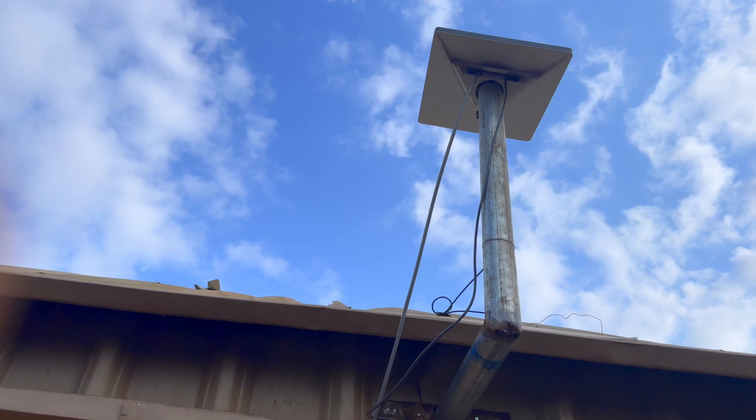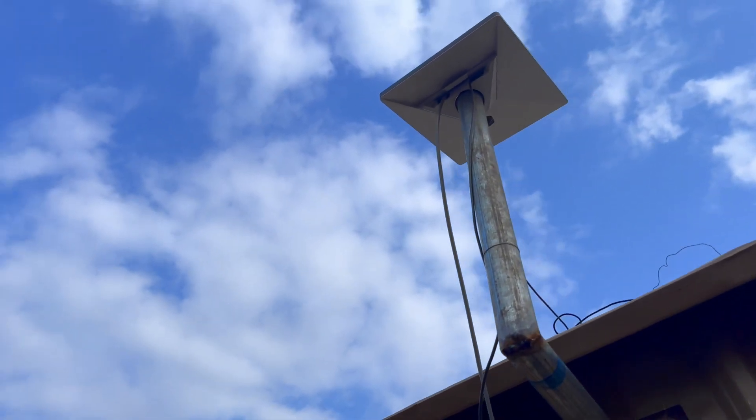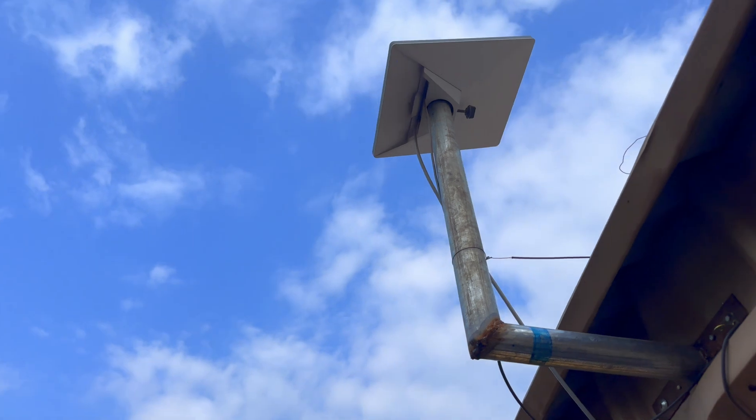Being one month plus, I've been able to get a TP-Link router that I use to connect the other side of the house. I'm going to show you exactly where I mounted the Starlink router outside. Being a Starlink Mini, the router is mounted inside the dish, so the distance you have from the dish will throttle down your Wi-Fi speed. I've been able to get a router here that serves every other part of the house, and I'm going to show you how I got that done by myself. In case you don't have the money to buy an extra router, I'll show you what you can use to solve this problem.